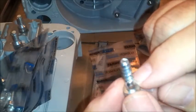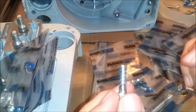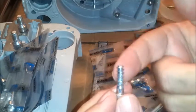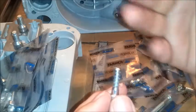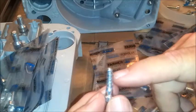Serrations. What it does is they give you, on the plastic, a specific size diameter hole that this goes in, and it cuts its own threads, displaces the material. After it cuts, it makes the threads harder so that you can screw it in and remove it as many times as you need to. These do not come with any microencapsulation — that's not needed.